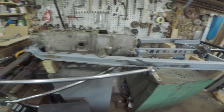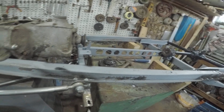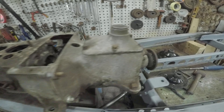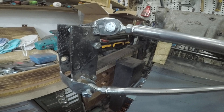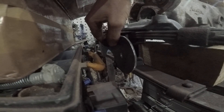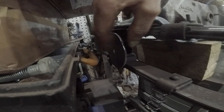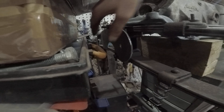As you can see I've got the chassis set out on the bench near my shed — I really need a bigger shed. I've got an old crankcase on here just to line up the gearbox so I know where everything's going to lie. On the front I've got the Bowden front suspension unit with top and bottom springs which act like wishbones. I've cut out a plate for that, and the old friction dampers were single, so I'll have twin friction dampers that come back down to a mount on the chassis somewhere.